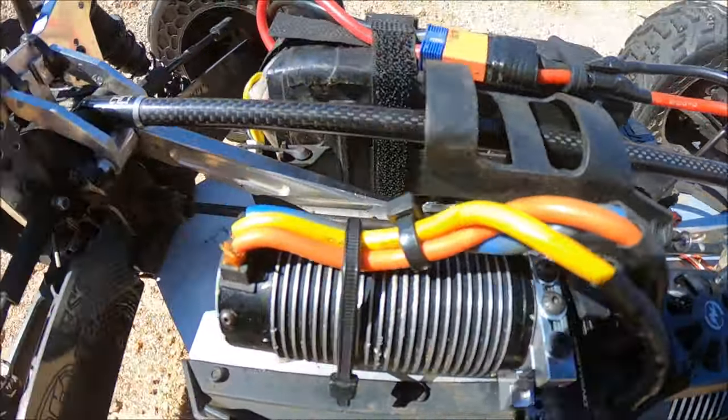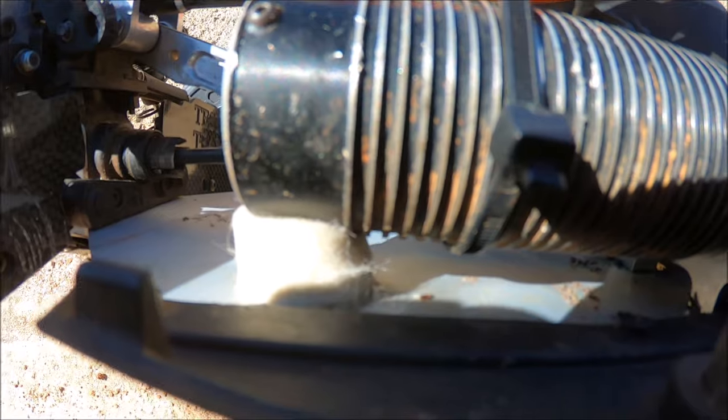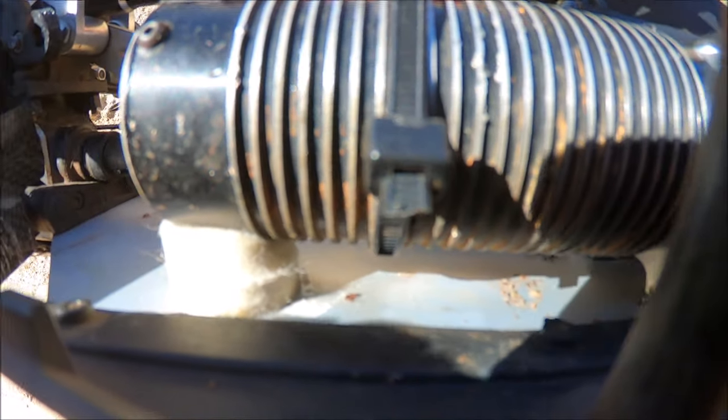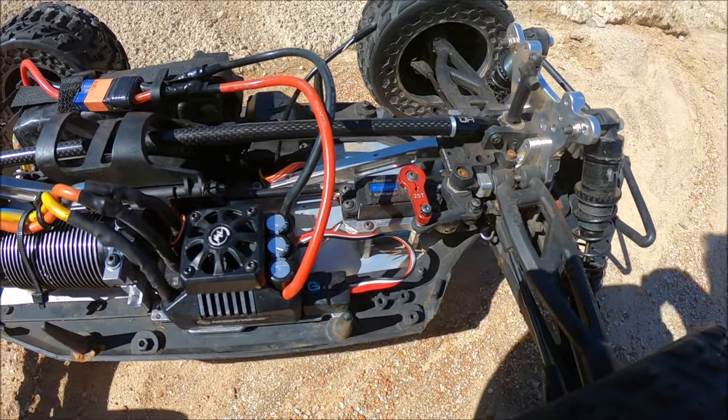The diffs are running 50,000 up front, 500,000 in the center, and 30,000 in the back. As far as the motor support, you may notice I've got some felt pads right here — they're actually Dremel polishing pads, which are kind of dense like felt pads. I've got two of them glued in there just to support that end bell. All right guys, let's give this baby a quick run.